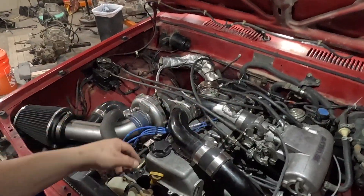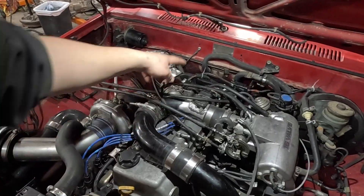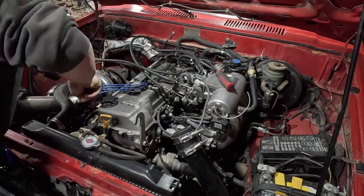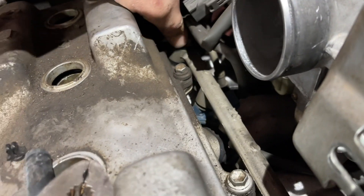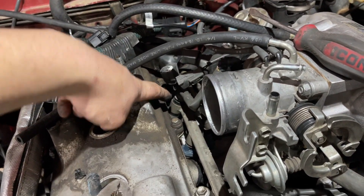I'm going to pull the injectors off, pull all the intake piping, and I got some slightly cooler heat range spark plugs to put in as well. When I went to change the fuel rail out I noticed the back fuel rail bolt was finger tight — one side was tight but the other was completely loose.